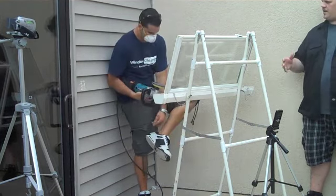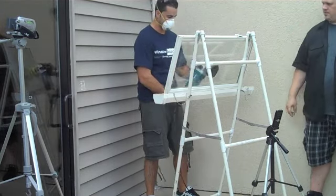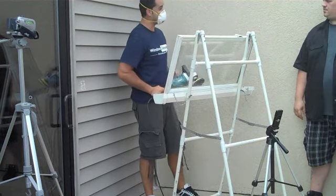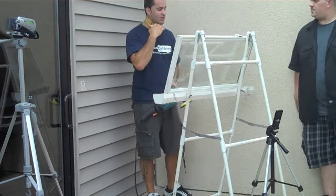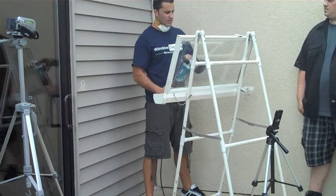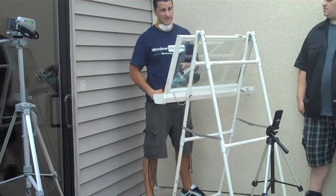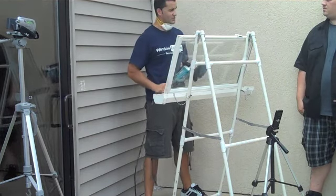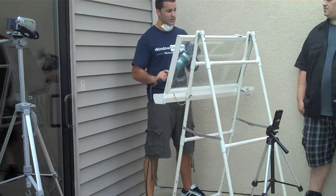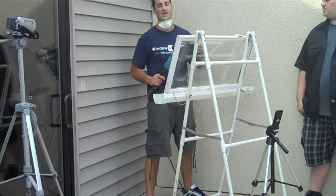Do you want to stay on a circular motion, side to side, up and down? Whatever is more comfortable. You can start more back and forth while moving up and down. The guys in the classroom who are very good at using this machine have crazy technique - they make a square that gets smaller each time and go in reverse. It's a little squirrely at first. It will slide off the glass on you and you're going to be repairing a lot more glass.